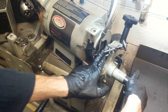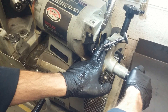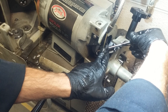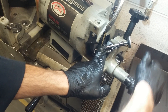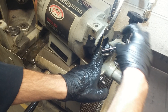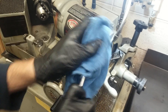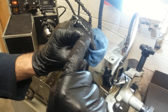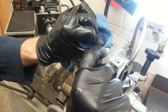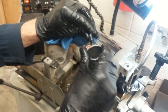I need to move this in slowly. When I get close, I just want to slow down. There we go — it just touched. Now I can rotate it like that, just give it a little tiny bit more. Now rather than grabbing the valve and pulling it out, we're going to back it off. If we've done a good job, we'll see that the whole top surface of the valve has been cleaned up with a nice new surface, and we've got a nice 45-degree chamfer around the edge. The chamfer is important because when we grind the face, it's what we use to center the valve into the attachment.